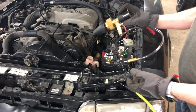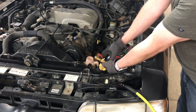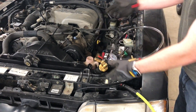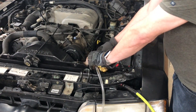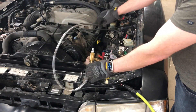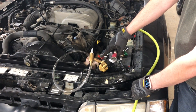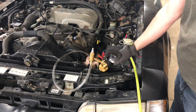The first thing you want to do is connect this to your overflow or your actual radiator cap. In this case, I'm just going to push it in here, because I already tried a different adapter and that didn't work, so we're just using the cone. Then we hook this up here, and you can just route the other end of that wherever you want — I'll just throw it into the overflow. Then we hook up the air supply.